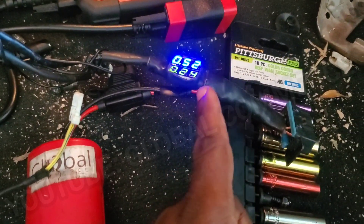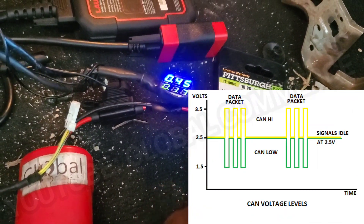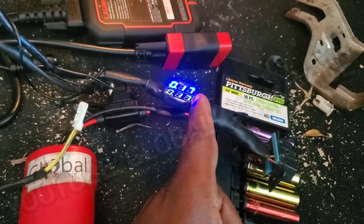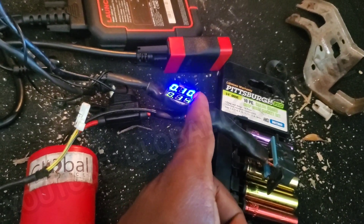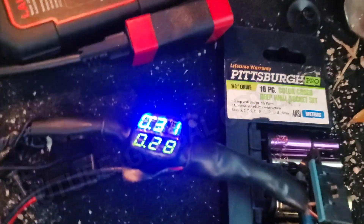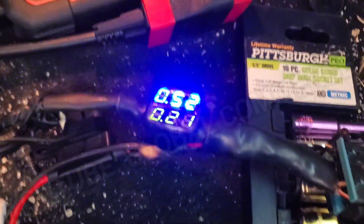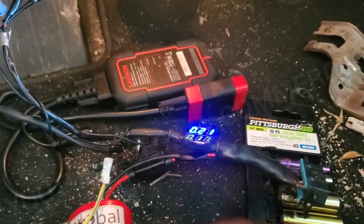I connected the ultimate CAN bus tester to a common ground. At the top is CAN high, at the bottom is CAN low. These settings should be about 2.5 to 3 volts on CAN high, and similarly about 1.5 to 2.5 volts on CAN low — basically the two readings should add up to about 5 volts. But right now we're averaging less than half a volt on both, which means the network is being pulled to ground. Something is offending on the network and stopping communication on the CAN bus.